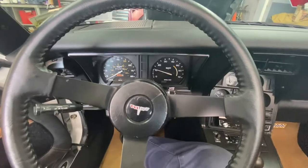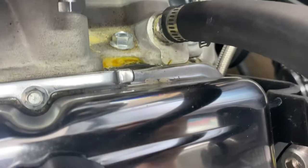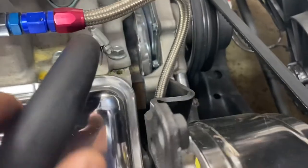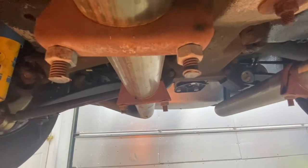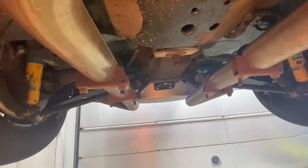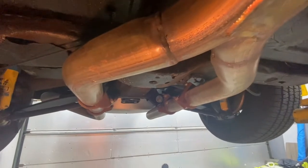That's about the best I'm going to get it for now. Keep finding more stuff — we've got a leaky heater hose over here. Let it cool off and I will tighten up that clamp; I believe it's the clamp that's loose. Taking a peek underneath, we have some really low-hanging exhaust clamps and hangers that have been scraping the ground already. We'll turn these around and flip them up, get them out of the line of fire. In a few minutes we have about another inch of ground clearance. When these guys put this exhaust on, they faced the clamps down — I have no idea why.